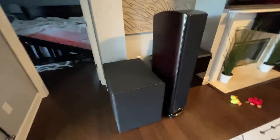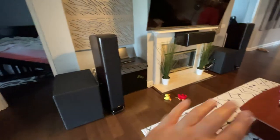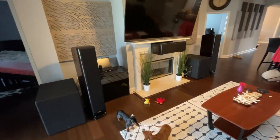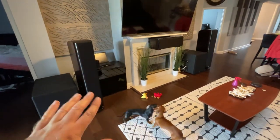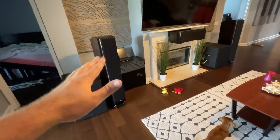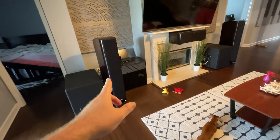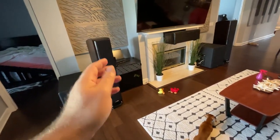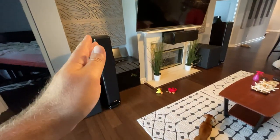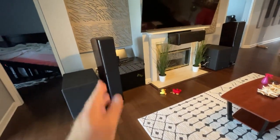The subs are in position — where they need to be. You can move them a few inches here and there; it doesn't make a big difference. I already know these spots are good for subs in this room from testing many subs here. Speakers are just roughed in, base configuration. This one is about 75% set. The front and back position doesn't change for this speaker — it's called the anchor speaker, coupling to the wall and the pressure in the room. That's already set.